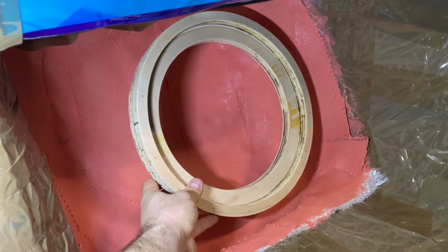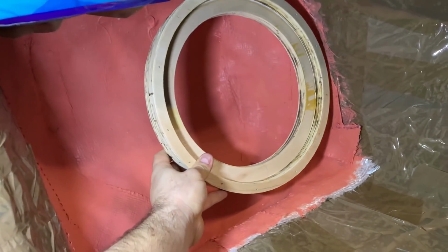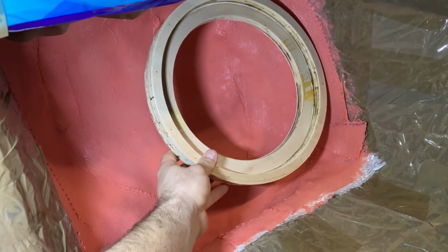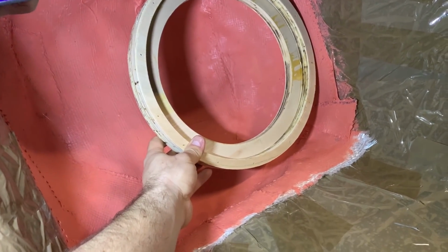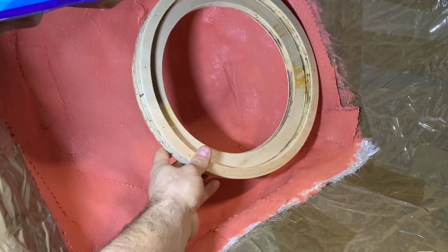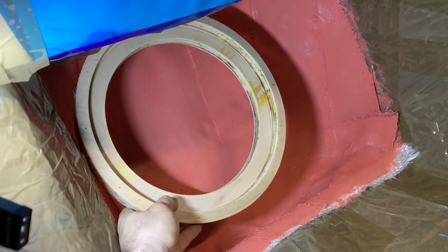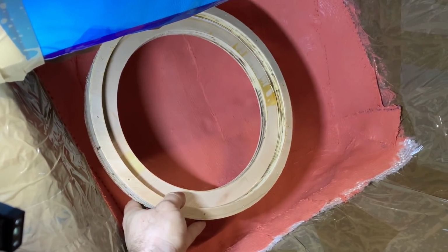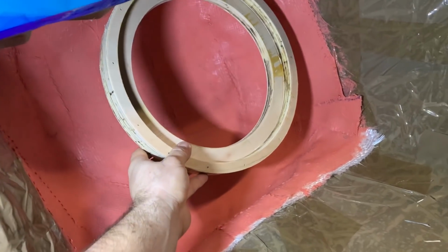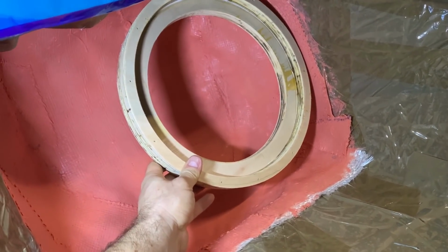So this is going to be below the baffle, and I'll push it more towards the center of the car, so we will have a better chance to make sure that you can't locate it that much off-centered. If it was in the middle or further out, then you would really notice that it's only coming from one side. But if we can push it towards the middle, we have slightly better chance.